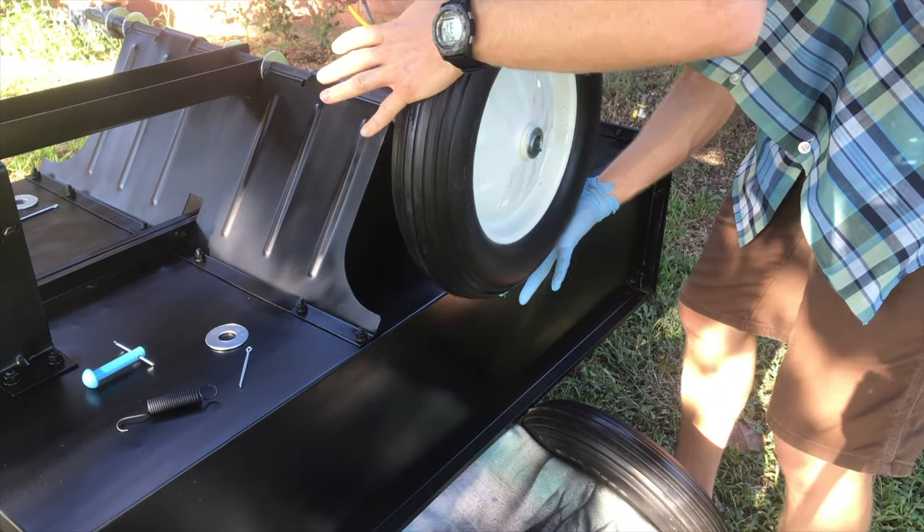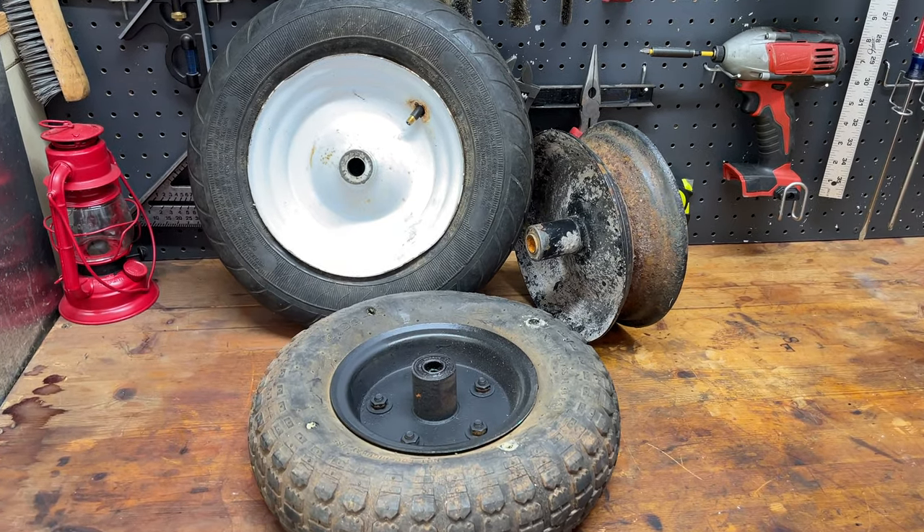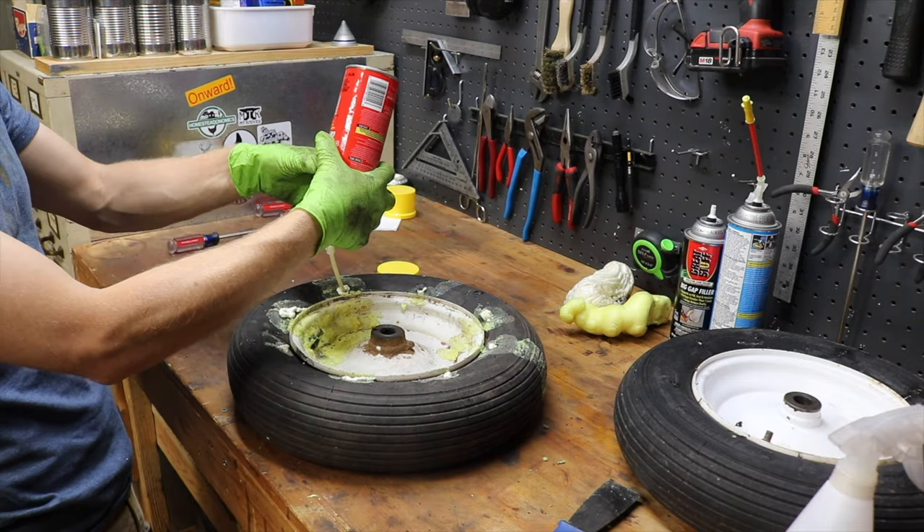It's interesting the comments you get on these types of videos. A lot of people said, 'Why don't you just buy a solid-state tire?' or 'I can buy a brand new tire from Harbor Freight for $12.99.' Guys, you've got to make sure you're looking at all the specifics — the axle bore size, the tire radius size, the wheel size — because replacing those two tires on that trailer are $30 to $35 a piece. You can't just go buy 8-inch wheels and use them on that little trailer to pull behind a riding lawnmower. Ultimately, you do you — figure out what's going to work for you. If you've used spray foam and had good results, or it was a terrible mistake, leave a comment below.